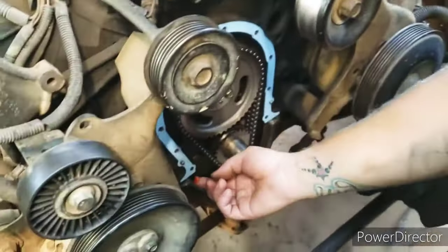I'm just waiting for the wife to get back so I can run to the store and grab that 3/4 inch fitting. In the meantime, I filled it up with oil, 7 quarts. I replaced this little guy, 2 little 10 mil bolts, not a big deal. And the nipple, actually, there wasn't anything left in there. Someone had already pulled out the nipple. So all I had to do was reinstall it. And I got the goo. I put on that red high temp RTV around both of these nipples because they're super corroded and pitted everywhere. And I just wasn't confident that was going to seal.